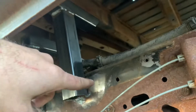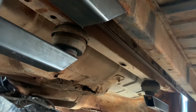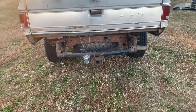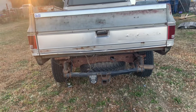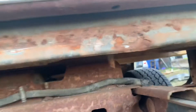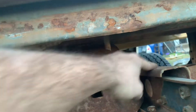I haven't finished all these mounts yet; I've just got a couple in place — enough to drive it. The welder wouldn't reach this side of both of these, which is why I wanted to get it moving so I could reposition and do that. The cab mount is actually the Suburban factory mount — I just reused that along with the bolt from the C10 and everything worked out pretty well. It now has upgraded polyurethane cab bushings. Out back, the rear bumper is going to be a little bit taller than I want, but the Suburban bumper would have bolted on right there and right there, so I'll make a steel replacement with backup lights integrated in. The rear mounts I haven't done yet because the welder wouldn't reach, but I'll make an L-bracket — either welded on or bolted in — same thing on both sides.